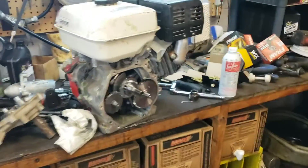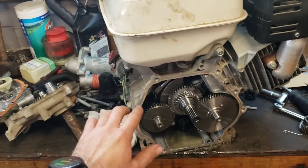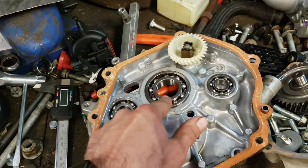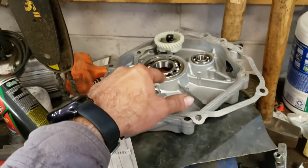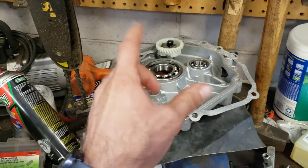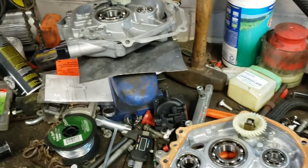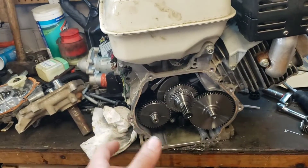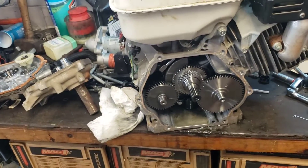After some digging, here's what I've decided to do. What I found is there's a bearing - I believe it's a 1.18 inch ID - but the OD of this bearing is much larger. The part numbers are 6206 versus 6207, and so this entire bearing on the new cover is bigger - bigger OD, bigger ID. One option would be to switch the crankshaft out to a standard crankshaft - not a ton of work, but it is additional labor - and I'm trying to keep the cost down for the customer.